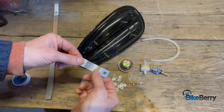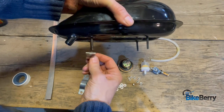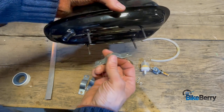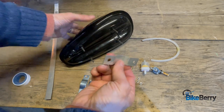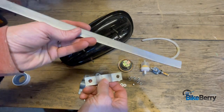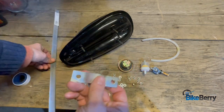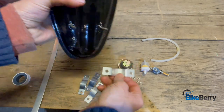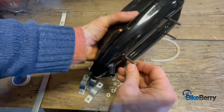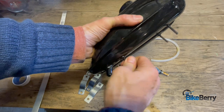What we're going to do is double up our straps. Normally you'd put the tank on the bike and mount this strap underneath the top tube, but we're going to take an extra pair of straps. If you don't have an extra pair, you can make the same strap out of three-quarter by one-eighth inch flat stock — bend it, curve it, do what you need. First step: put nuts on there first, so you'll need double the hardware. Seat them all the way down.